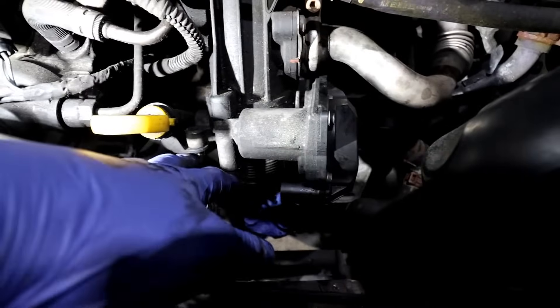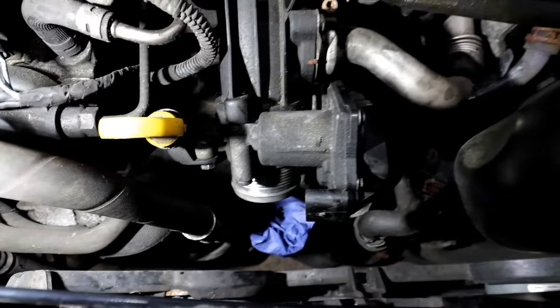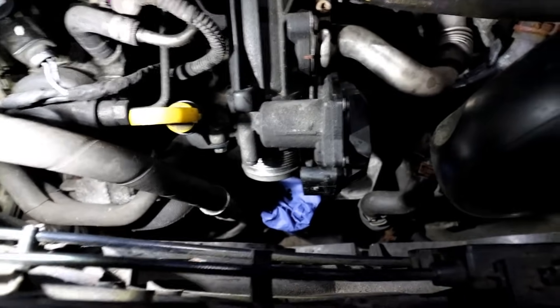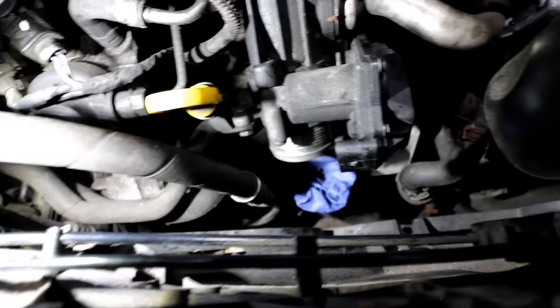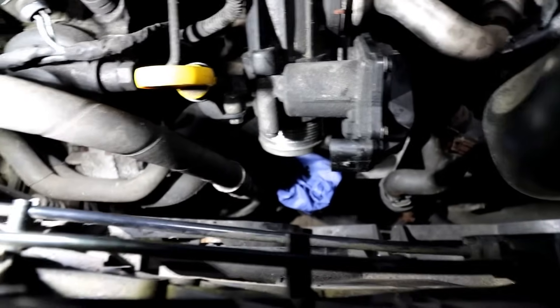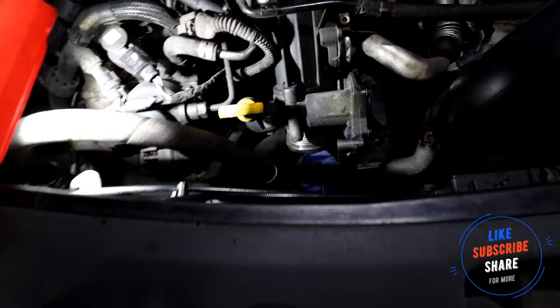The unit is on there guys — I've bolted on the dipstick as well, so it's all on. The bolts are tight. You don't need to do them too much because they're only going into plastic — it's around 10 newton metres, but I'll double check the torque settings and put it in the description below. I kept the glove on there because there were carbon bits falling out as I was removing it — that stopped anything going into the intake. Take the glove off and install the hose. Once the hose is on, plug it in and clear the fault code.